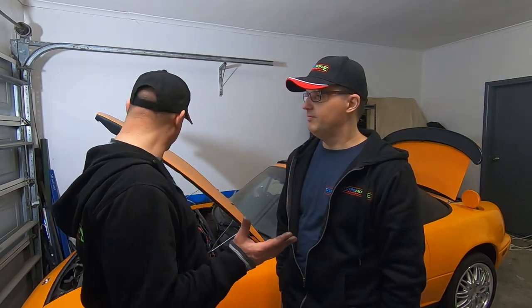The only other thing is we just couldn't get it across the line. We've got a bit of a gremlin in the system. Most of the things are talking. So we know that the batteries are working, they're connected, but we don't see that on the battery management system. So once the battery management system is talking to us, we can drive the car with confidence. Technically, we could drive it now, but we don't want to drive it without the battery management system talking to us. Safety first.